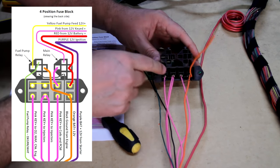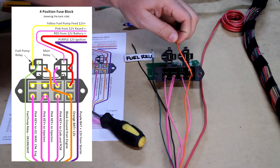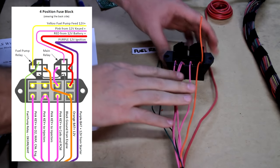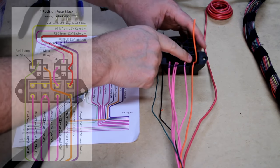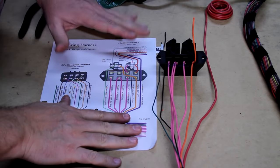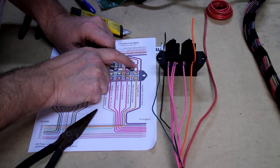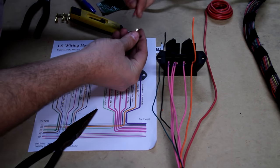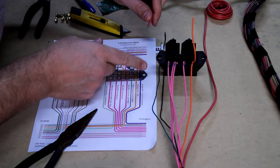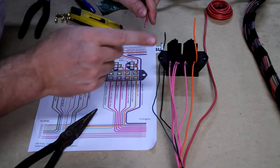Now I'm going to bridge this - this has got to go into this. I'm going to get it here and cut it to length, cut it off right here, and we'll get that done. Now I want to start working on fuse one, which is over here, and get the power supply side to it. The way I drew this there's going to be a little physical problem - I can't fit two wires into one position. So I'm going to make a jumper, come off the supply wire and split it into two different wires, then put one into each. The functionality will be the same.